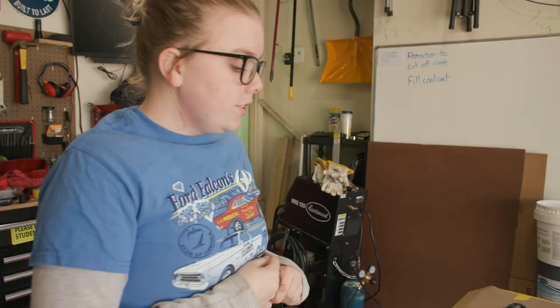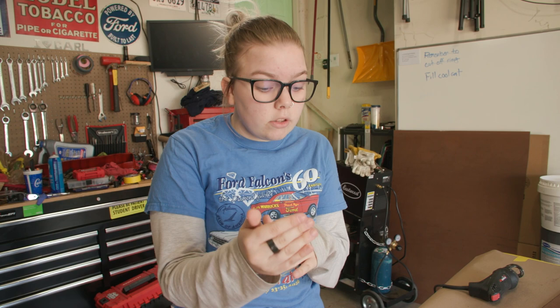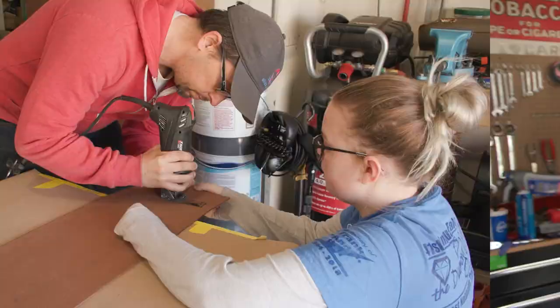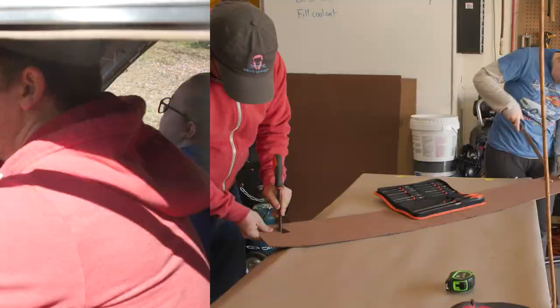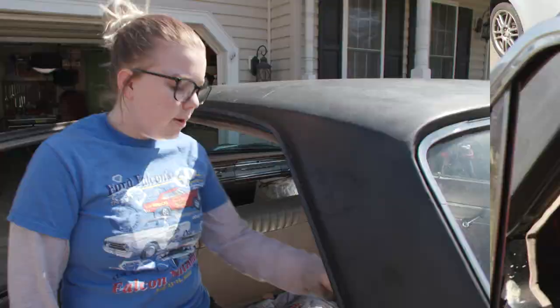We are a little small, especially on the passenger side - it's rubbing a lot on that side. So we are going to widen the gaps towards the front and towards the outside edge a quarter inch to get plenty of room for when we put the vinyl and any lining in there so that no rubbing occurs. This hole's going to be great. We got it lined up - it looks pretty good. It looks like it doesn't have enough clearance, but it a hundred percent does. We didn't get it right the first time, but whoever does.